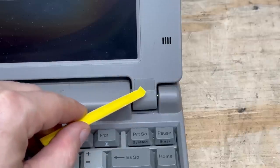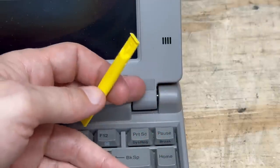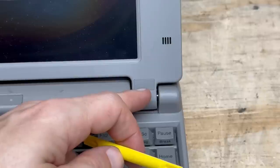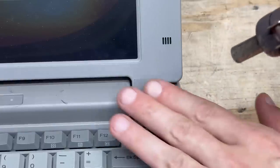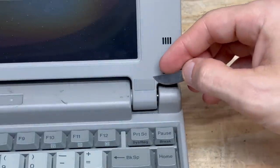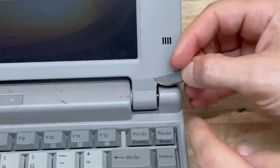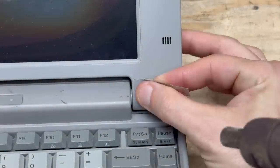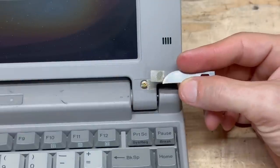I've got to get these little plastic stickers off because there are screws behind them. This thing is already pretty warm from all that dooming. I'm going to give it just a little bit of heat to soften the adhesive. I have to excuse the noise from my hot air station — it takes a minute to shut down. Now coming in with an exacto knife blade to get under that sticker. Need a little bit more heat. Got most of the adhesive — it is pretty brittle.